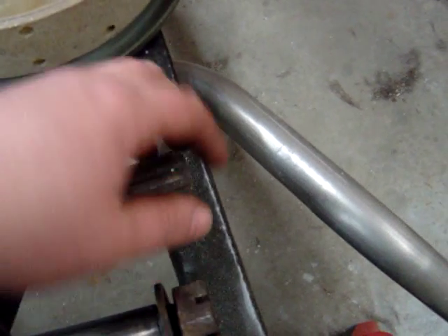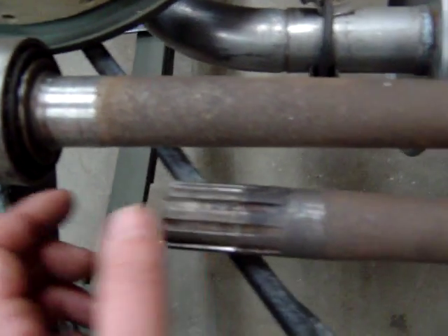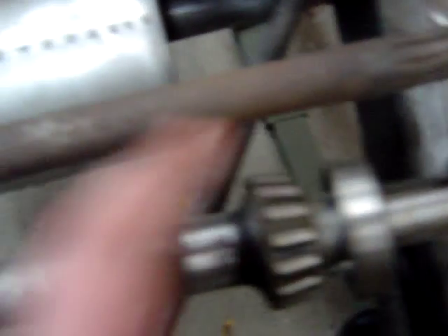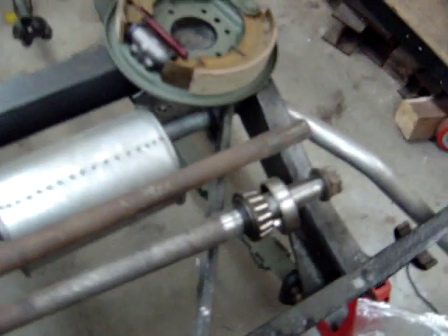Right shim pack. Once this goes together with these axles here, you've got to set up the preload for these bearings — these will be shimmed in. The axles butt up against a piece in the middle and the other axle comes and butts up against that one, and then you set up the side clearance on the axles so there's not too much back and forth, and it keeps the load on these bearings to keep them from slopping around.